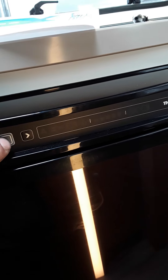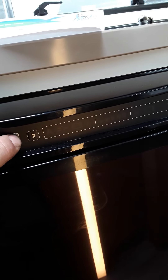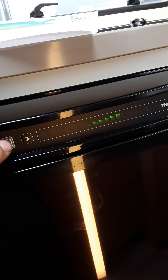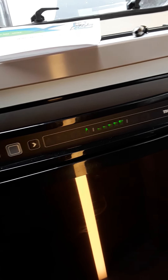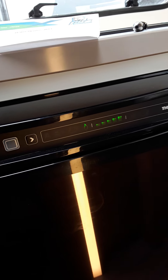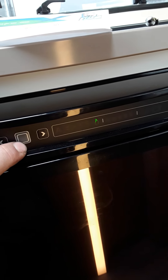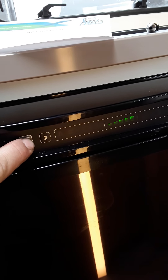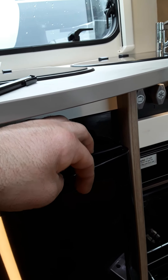The fridge selected gas by itself because that was the only power supply it could find. Once it is flashing, scroll through to what you want — so we will go onto gas. Press the middle button again and you will see your temperature levels flash. Press again and that is you set on whatever mode you want. Press the middle button with the flashes, scroll to whatever option you want, press the button again and press the button again.